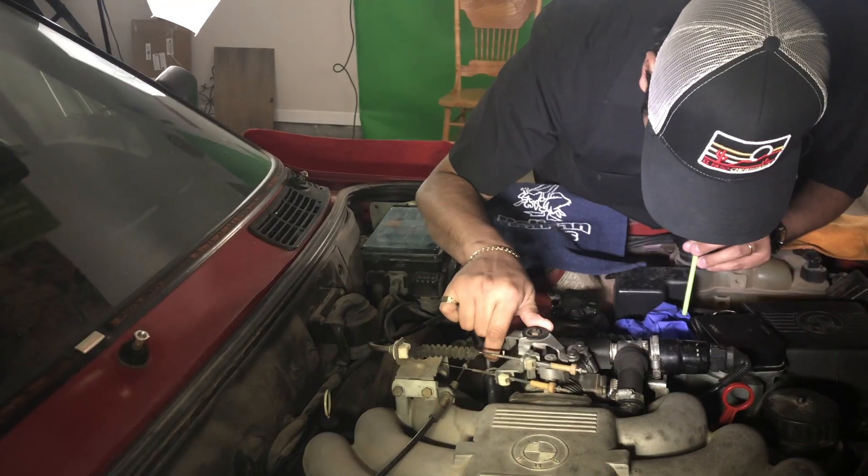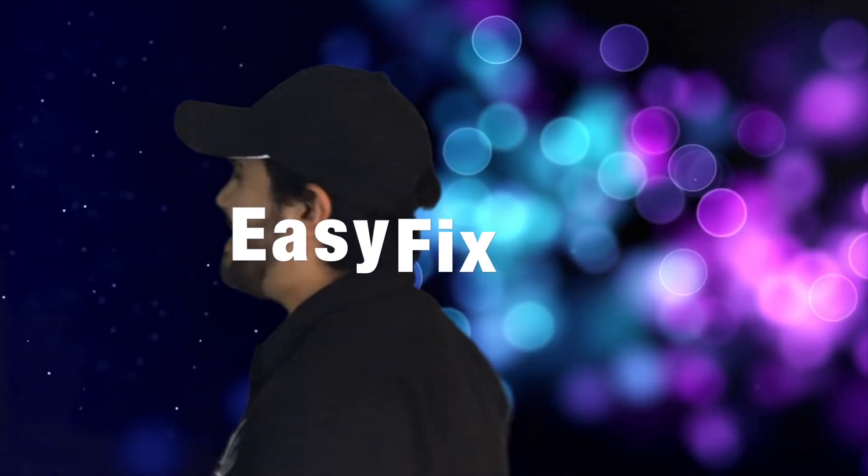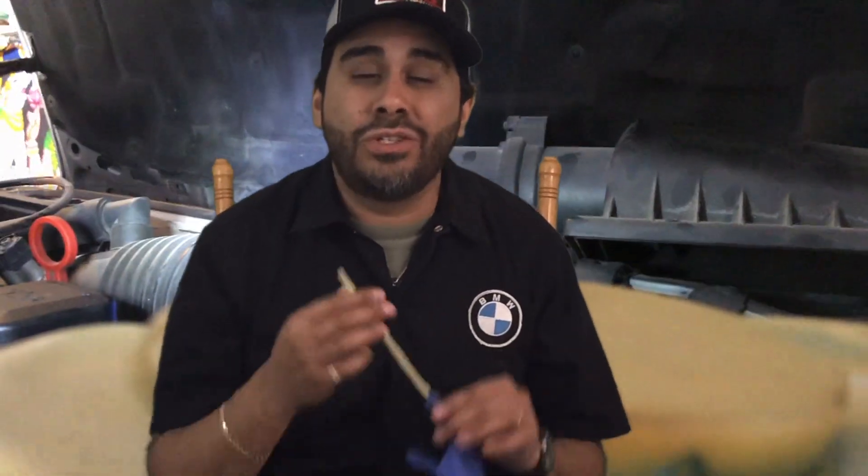If you can't hear it, go ahead and try the smoke — you're definitely gonna see it. If there's a lot of compression and the rubber glove begins to inflate, then you probably don't have an air leak. Specifically, if there's a lot of compression you can feel it in your mouth through your lips, then you probably don't have a leak, and you'll notice the glove will inflate.